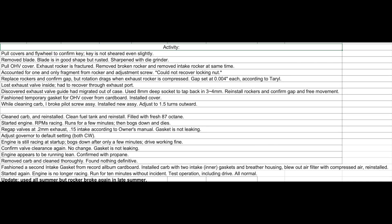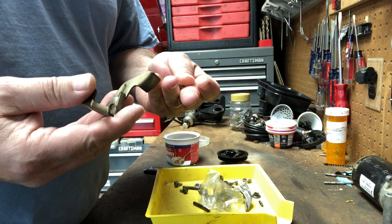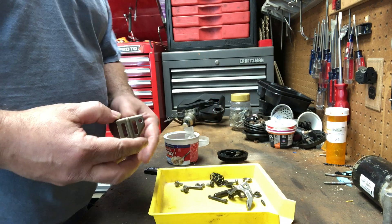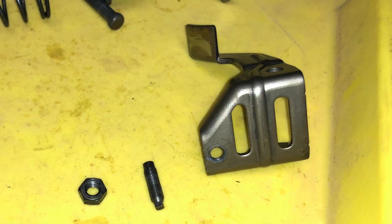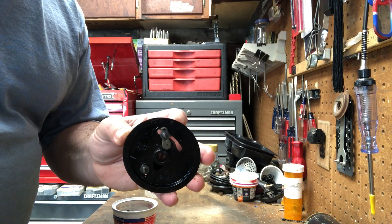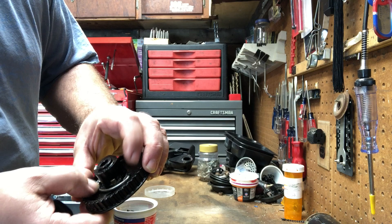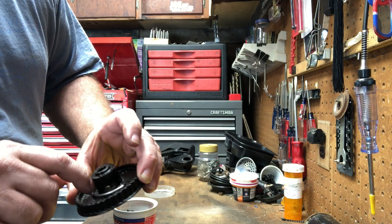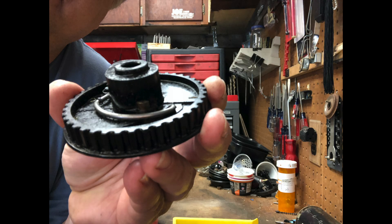Here's a description of all the work I did last season on it. Here's the initial fractured rocker and the piece, the adjustment screw, the second broken rocker, the individual parts, the adjustment screw, the locking nut. Here's a close-up of the cam and how the compression release mechanism actually bumps the exhaust valve to relieve the compression when you're pulling the cord.